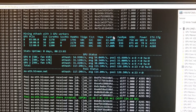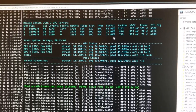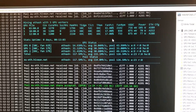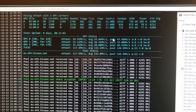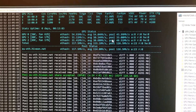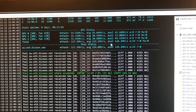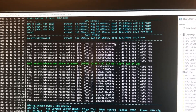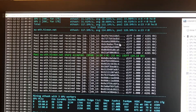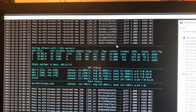The hotspot was 106 to 110 and memory was around 100. So I dropped about 40 degrees on the GPU temperature, almost 55 degrees on the hotspot, and around 15 degrees on the memory. And those previous temperatures were at 100% fan — now it's only 60%, so it's super quiet.